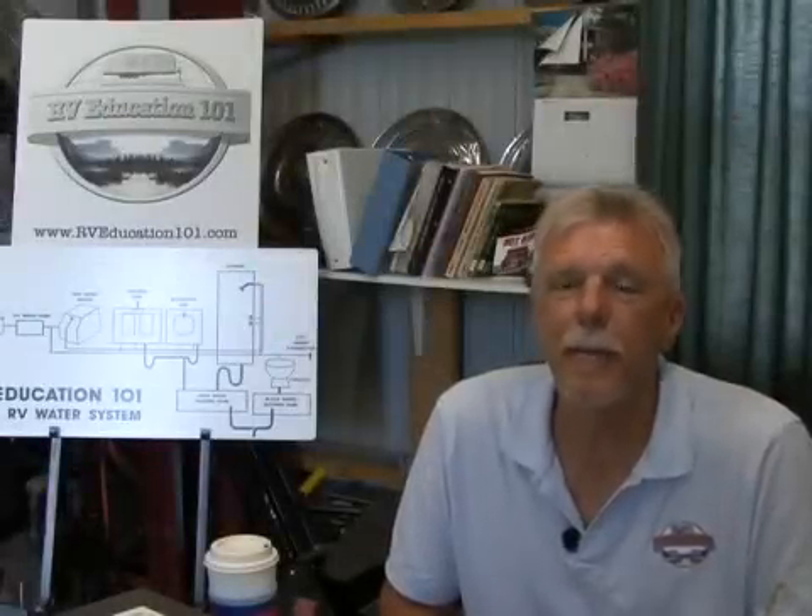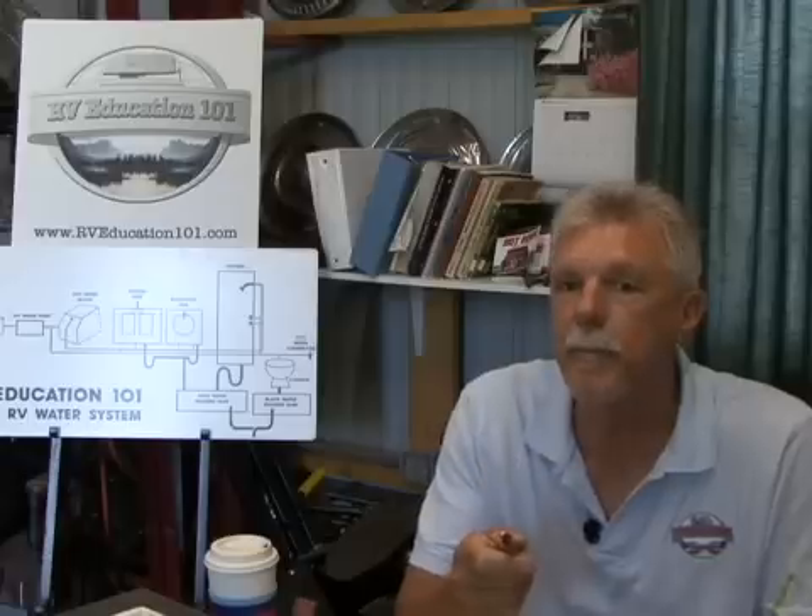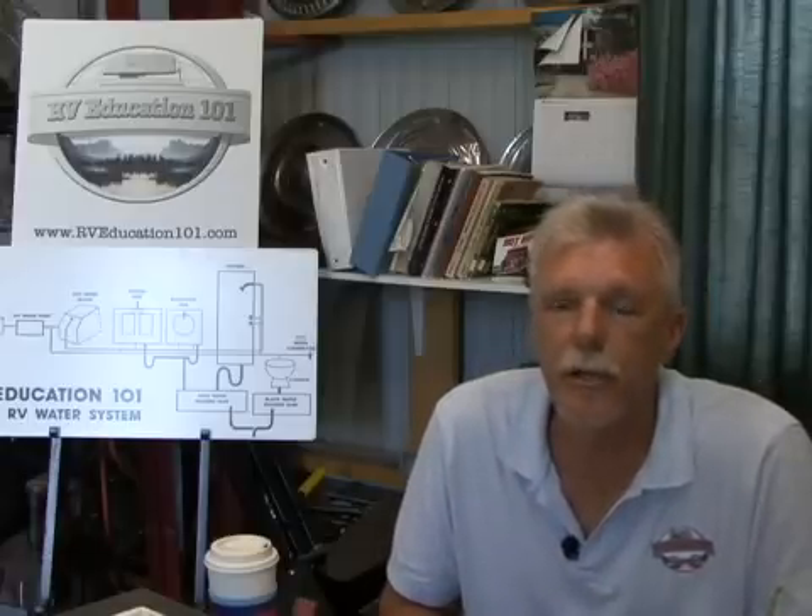After some research, I discovered the TireMinder TPMS by Minder Research. There were several models available. I chose the 400 series model because of the features it offered, like monitoring up to 22 wheels, a pressure range of 0 to 145 PSI. It's user programmable so you can set it up to match your particular needs, and it's easy to install and use. I like the fact that there is a visual as well as audible warning system if you experience a loss in pressure, and there's a temperature alarm if the tire temperature rises above 167 degrees Fahrenheit. Another added benefit was that you can replace the lithium batteries in all of the transmitters when the battery dies, rather than replacing the entire transmitter, which can get very expensive.